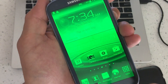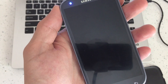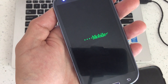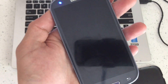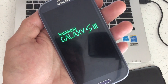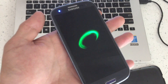So we're in safe mode now. To get out of it, hold down the power button and select restart — this will get you out of safe mode. When you're in safe mode, it only loads the minimal apps and services just to get your phone up and running, so all the stuff you downloaded won't appear on the phone. A lot of you are thinking it deleted all your apps — it didn't. That's what safe mode is for. Once you get out of safe mode and back into normal boot, everything will be back on your phone.